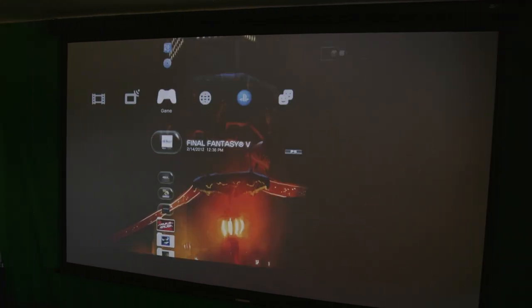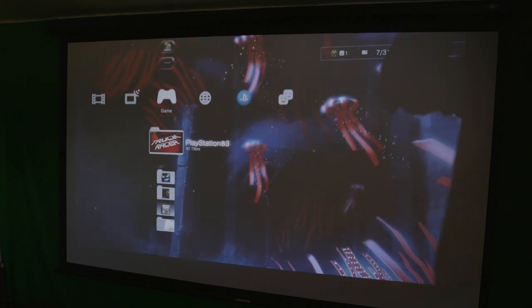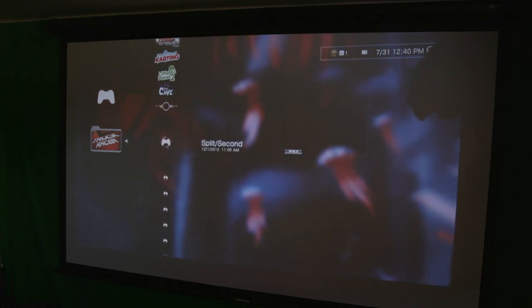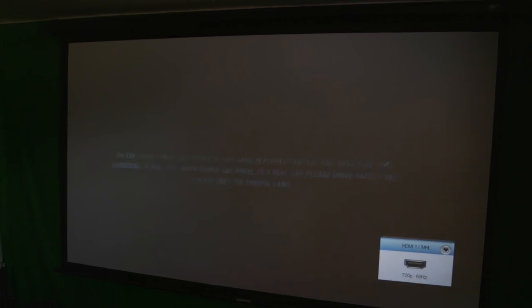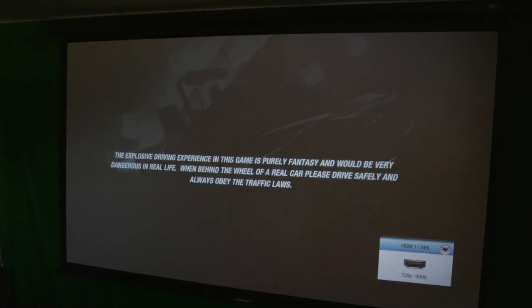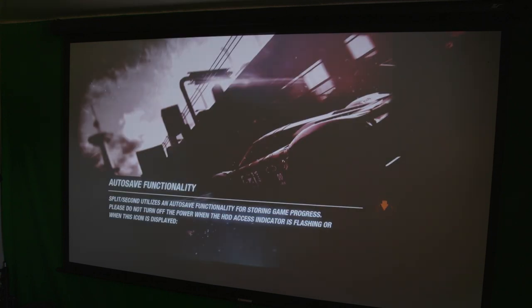All right people of YouTube — I got the projector up and running, set on my desk. As you can see, it's working so far. All I did was take out the color wheel and clean it with some screen cleaner and a microfiber cloth. It felt like it wasn't doing a great job because there were still some smudge marks and it seemed like the color might be rubbing off, but from the looks of it all the colors are still there and it hasn't started doing the flickering yet, which normally would be happening by now. I'm still going to get a replacement color wheel.